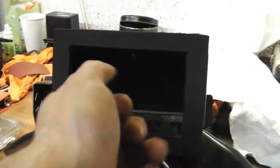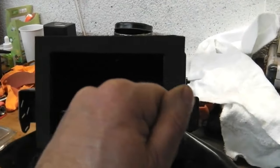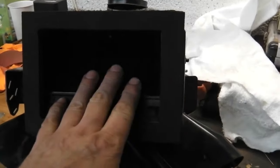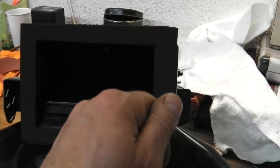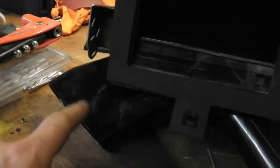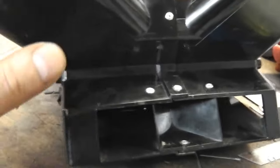So you can see that not only does that detent lever on your dash, so imagine my hand now, I'm on the fan speed control off, speed one, full speed, all the way across like that, closes this, because you're telling it to turn the heating system off, so nothing's coming to your feet, nothing's going to the vents, and if you vent fresh air, nothing's going to your feet, and nothing's going to your windscreen, the demist, completely blocked. The other flap is the feet and windscreen diverter, so all the way to your feet, or the other way, all the way out of here to the windscreen. So that's that one, that just simply toggles it between the two.